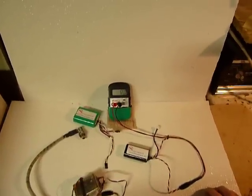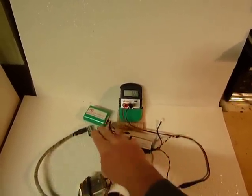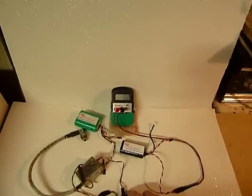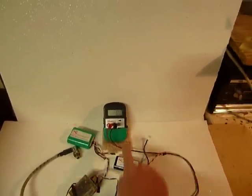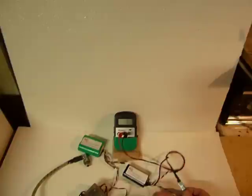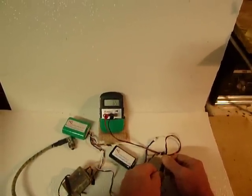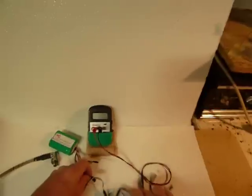From Wrong Way RC — this time we're looking at a couple of A123 batteries and an electronic ignition. This is a DLE 30 electronic ignition, also made by R6L, so it's the very same components. Plugged into the voltmeter is an A123 1100mAh; I have taken the energy out of it and reduced it down to 6.5 volts no load, so that represents a battery that's fairly well discharged.